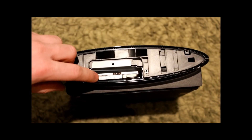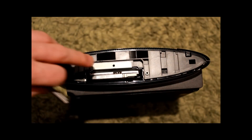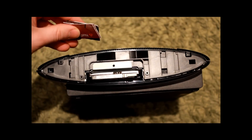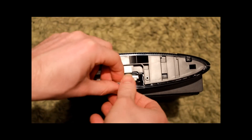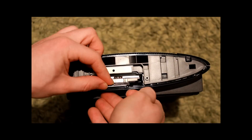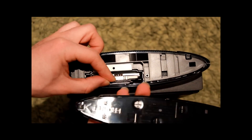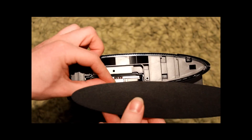You can see all the space around the drive, and if horizontal it would end up sitting loosely. So what I'm going to do is take a credit card — I've cut it into four pieces. I've had a little experiment and four pieces seems to be the optimum number for the correct thickness. I'm going to slide that just under the hard drive so that when I move it horizontal the drive sits nicely in place. Then take the panel and slide it back onto the case, push and close.